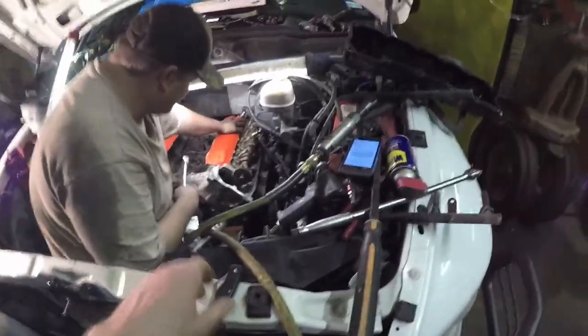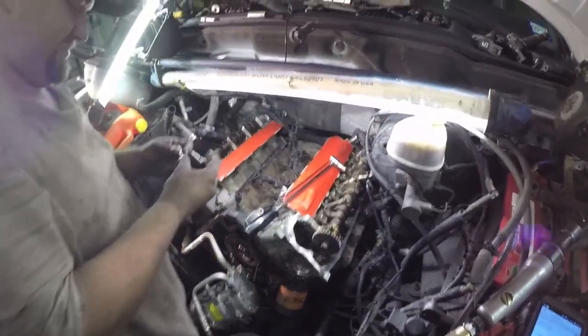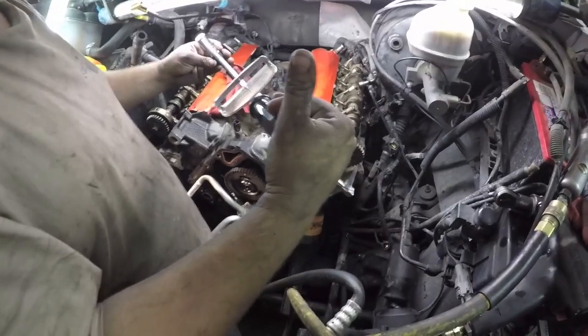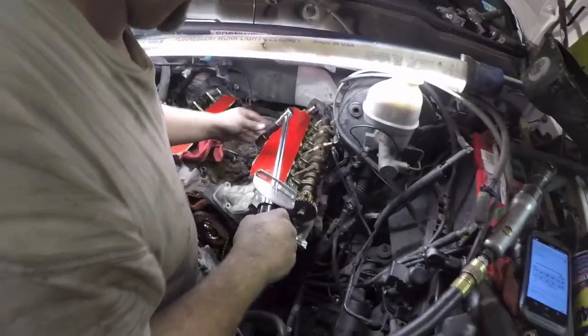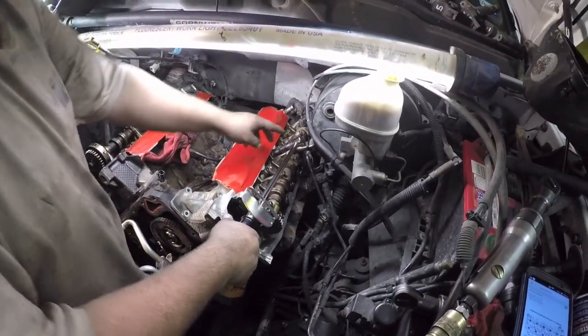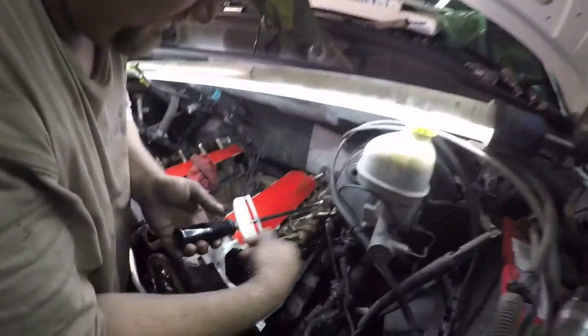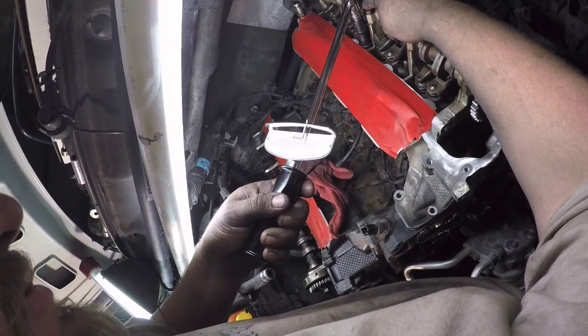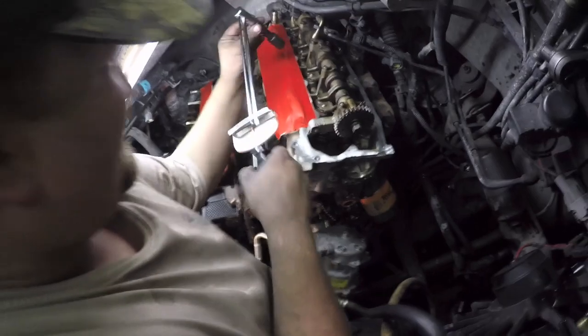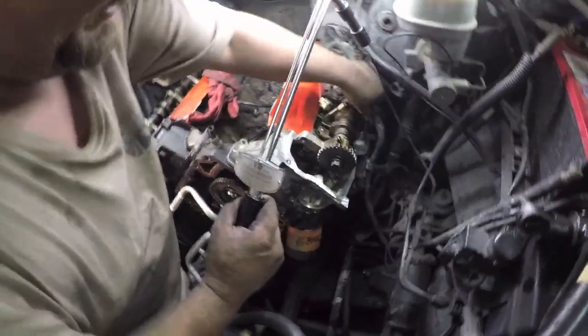I wish this was an old truck so we didn't have to remove radiators to work on them. I'm not a mechanic when I do mechanic stuff. All right, so what are we doing here? First round, 15 millimeter. Does it feel solid? Sure — feels like America, feels like marginally more freedom than we have today. Just want to check my chart real fast to make sure I'm on the right bolt. So first one is 180 inch pounds — we're gonna stop right about there.